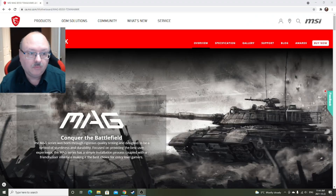I'll have a link in the description, but you can always just go to MSI.com and search it out — it's pretty easy to find. So when you're flashing your BIOS, first you've got to find the BIOS file. You can see this is the Canadian website, MSI.com. It takes you directly to where you need to be. Go down to the website, find your motherboard, and then click on Support. Once you've done that, you're going to see the BIOS section down there — click on where it says BIOS.